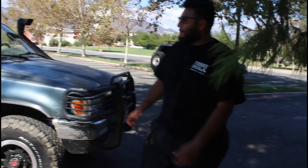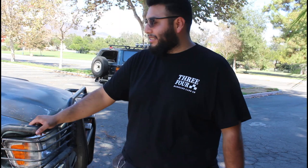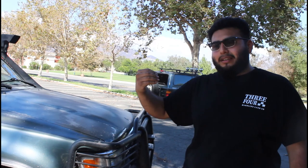So it's a second-generation 4Runner, 1993 model year. It was green originally. Under the hood it's the infamous 3.0 3VZ — the one with the head gasket issue. I've had really good luck with this engine. Once I had to replace both head gaskets, it was actually the passenger-side bank that went out — it started leaking from the side, which made me believe it was a water pump issue until eventually water got into the cylinder chamber.